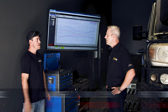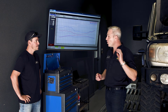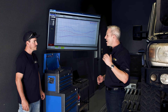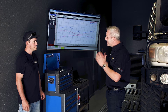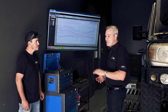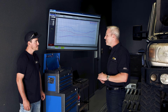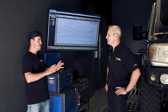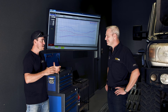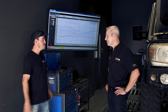Any customer has got to be happy with a 30% increase in power and a 50% increase in torque — those are great numbers. But how does it achieve that power? This rail pressure chip asks for more pressure all the way from when you turn the key on to when you turn it off — whether you're going up a hill towing your boat or parked at the lights. That puts a lot of stress on all components of the fuel system, including injectors and the fuel pump, which are very expensive to replace on a common rail diesel. You're already asking a lot out of that system, and increasing the pressure only asks more and could potentially damage the whole fuel system.